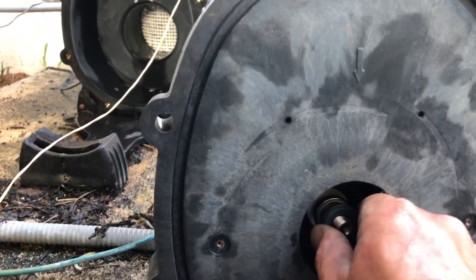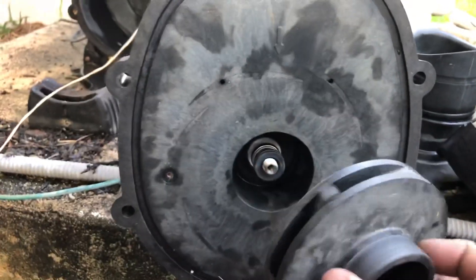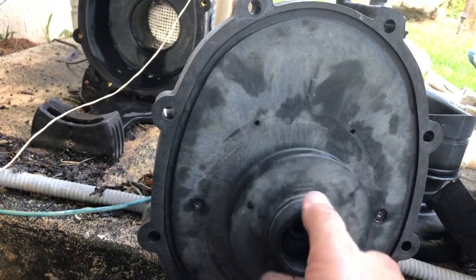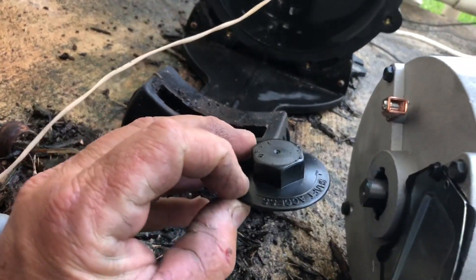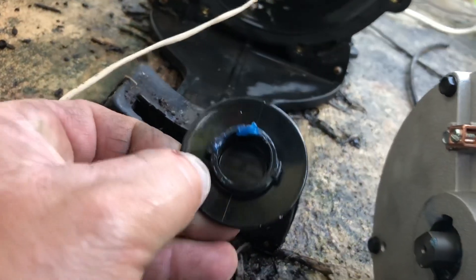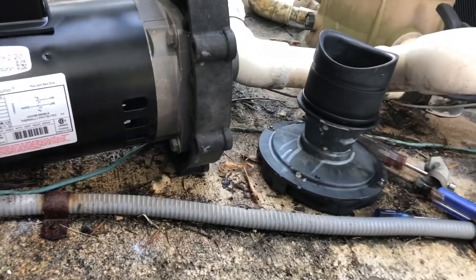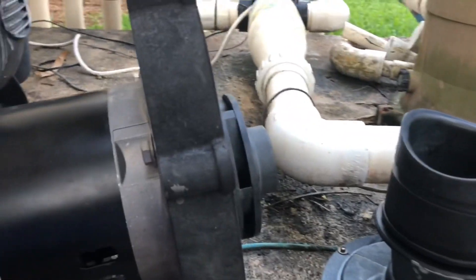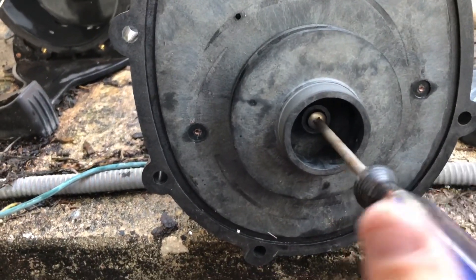Gently push it on and that's it. Now comes our impeller — we'll put it onto the motor shaft. The shaft cover has two tabs on either side that go into the top and bottom. You can use a half-inch wrench to hold the shaft so you can tighten down your impeller. Hold the shaft with one hand and spin on the impeller with the other. Then put back the impeller screw — remember it was right to loosen, so this one is left to tighten it down.